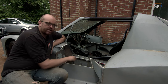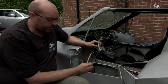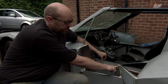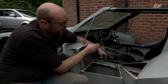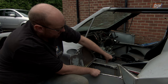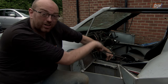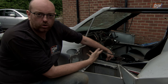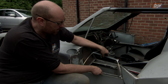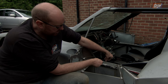With both drip channels in I've also been able to start making the door that will sit on top - this is the hatch panel that will go over this section. It basically just fits on like that - it's some inch bar, some 10mm tube and some half inch box cut down into a piece of angle so it just sits over the top. The plan is to have it hinge and open up. I don't want it going one way because then you can't get into it from the inside of the car, but if it opens the other way you can get in from both inside and outside.